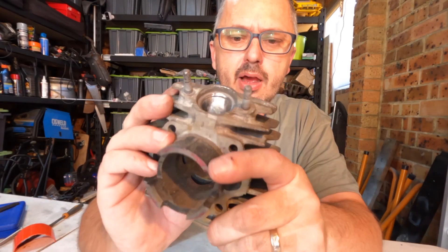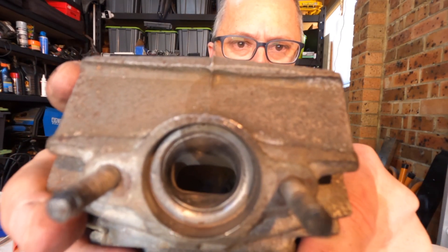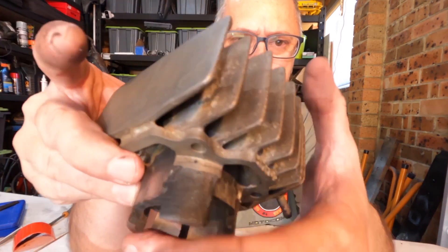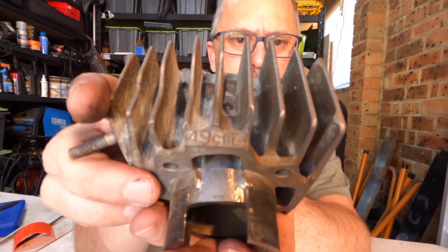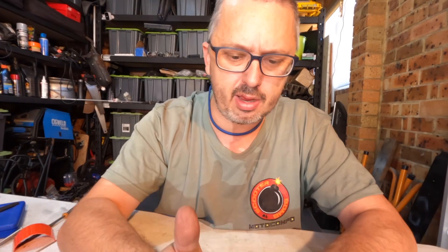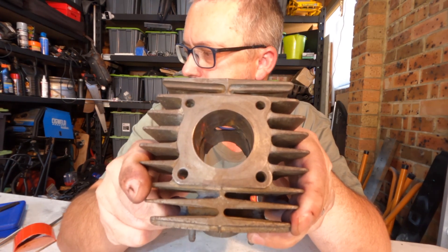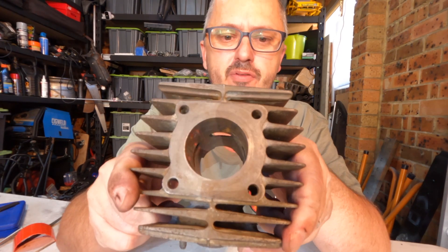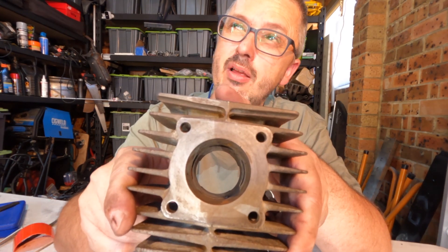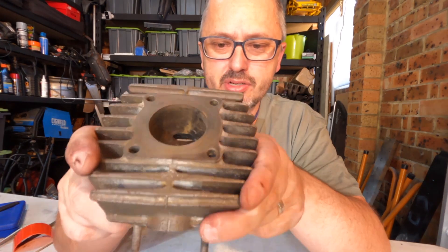Here is the cylinder — it is pretty much done now. Just opened up the exhaust port there nice and wide at the exit, and smoothed it out all the way through to the cylinder itself. We've smoothed out the step on each one of those ports around the side, which will dramatically increase the way that the air moves through into the cylinder. From here I'm just going to put the top of the cylinder on a sharpening stone to make sure it is perfectly flat and do the same with the cylinder head. The benefit is maybe it will increase the compression just a tad — maybe 0.2 or 0.1 horsepower, miniscule, but hopefully it all counts.